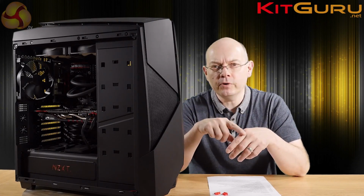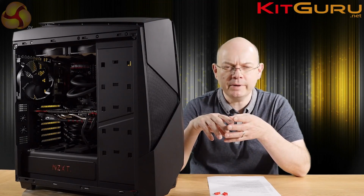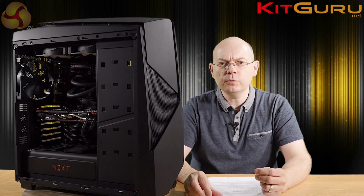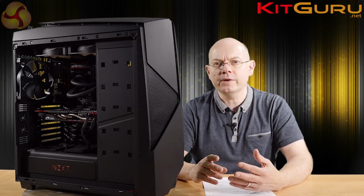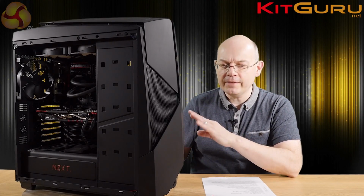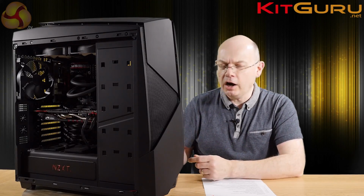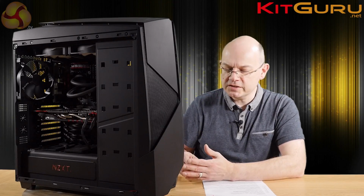Also, the revision 1.5 to 1.6 update appears to be very minor. It's to do with PCI Express compatibility. I didn't go there. The various drivers, on the other hand, many of them were quite out of date. Now, Vibox tells me this is to do with their process of installing drivers and Windows when they build a new PC. This particular PC happens to have Killer hardware on the motherboard, and that apparently throws their driver installation out of whack or some such. Either which way, if they'd installed Live Update, it would have sorted most of those things out.